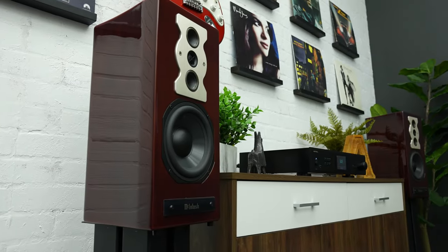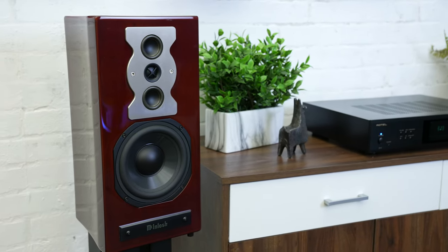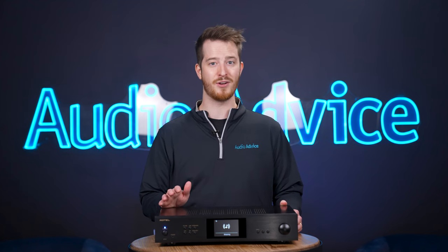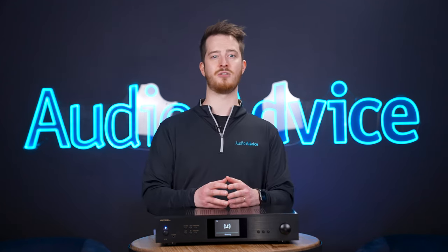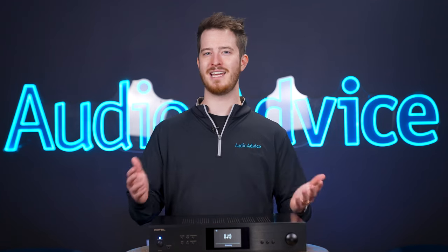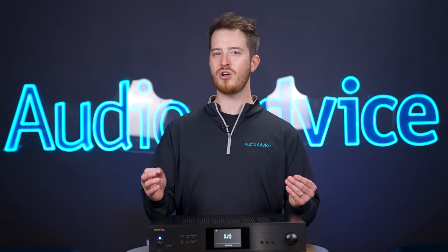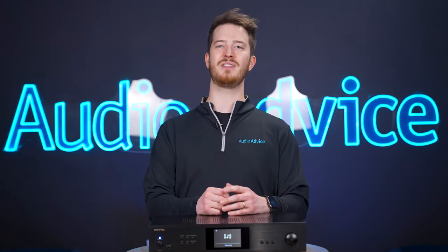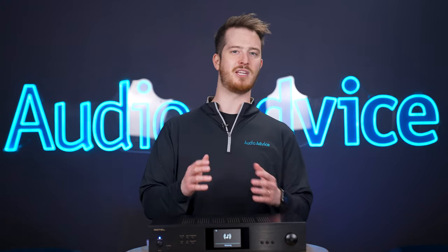We had the S14 connected to a pair of McIntosh XR50 stand-mount loudspeakers, which spec at a sensitivity of 81 dB — a difficult load to drive — and being 8 ohm means it's getting the lower 80 watts per channel from this amplifier. We would not dare pair this speaker with an AV receiver or a cheaper integrated, as it would not have the headroom to power them. The S14 has a larger transformer and stiffening capacitors not found in lesser units, giving it quite a bit of headroom to spare. Listening to the 2014 album Live at HQ Los Angeles by Legacy Recordings, we were able to drive the XR50s to around 83 dB and the Rotel S14 kept its composure — only pushing above this level did we start to hear strain and the soundstage begin to collapse slightly.